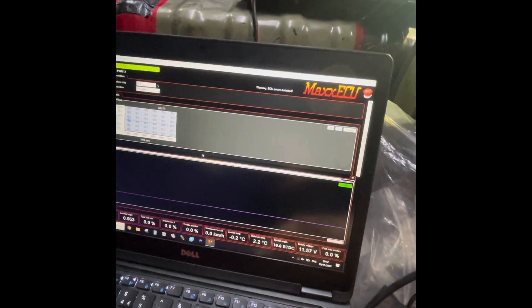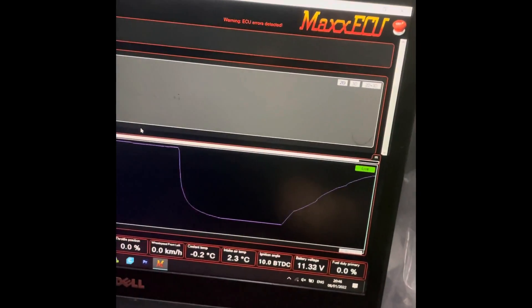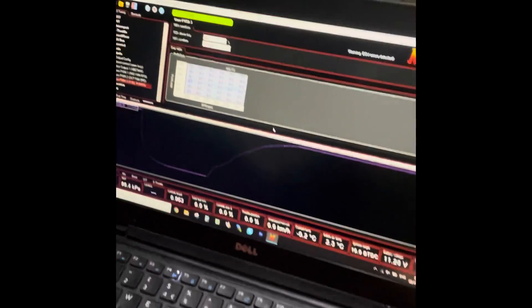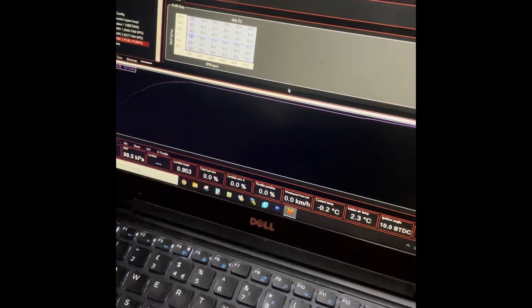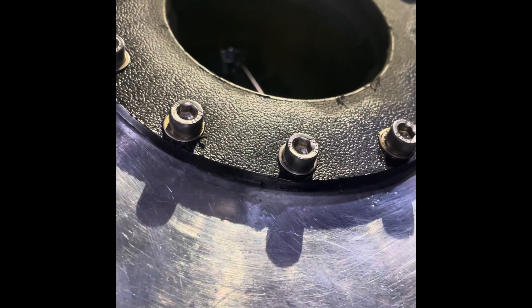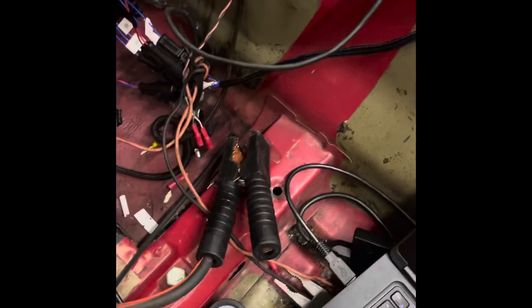We have no fuel pressure at 34% duty. One click — that's the one. 5.13 volts. 14 amps for both pumps. We'll just increase this duty — 30, 40, 50% duty. Things happening so far. Even that small run there has killed the battery, so I've got to run up to another battery. Just everything through a seat bolt there. We'll give it some time to charge.